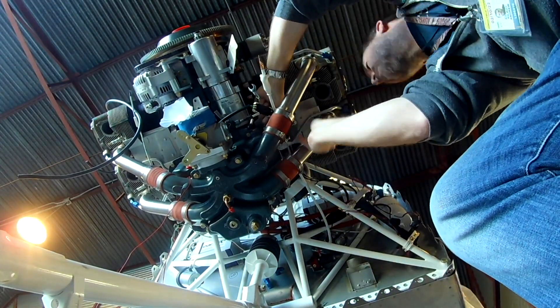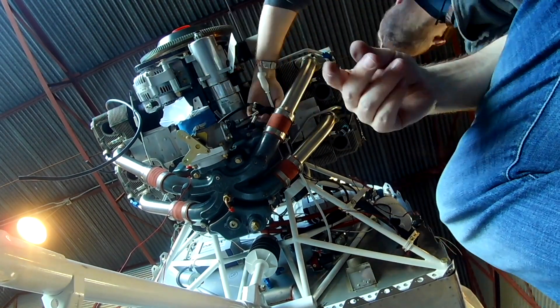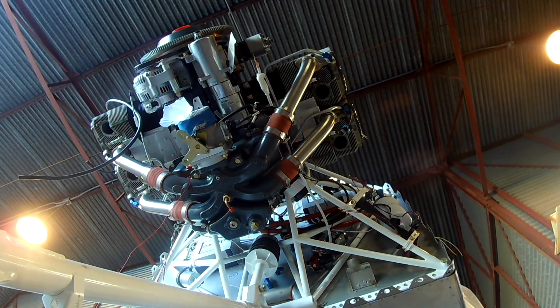Down the right-hand side we've got the main alternator line back to the bus manager — the actual feed line, which has two wires. Also attached are one wire for a warning light for the alternator and another for the alternator field, so that I can turn the alternator on and off at will.